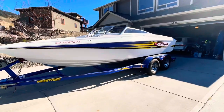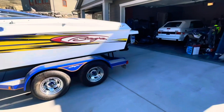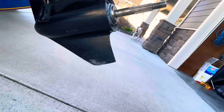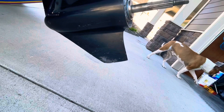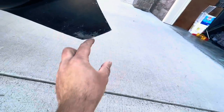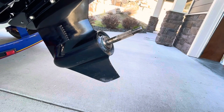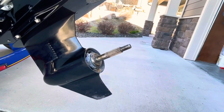In this video we're gonna get this boat ready to take out onto the water. I'm gonna clean these splines off and put on a skeg guard, so I'm gonna do that first. I'm gonna lift the leg — it took that much off — so I'm just gonna cut some of this off and then tap on the skeg guard. I'm gonna clean the splines off and put some grease on there.